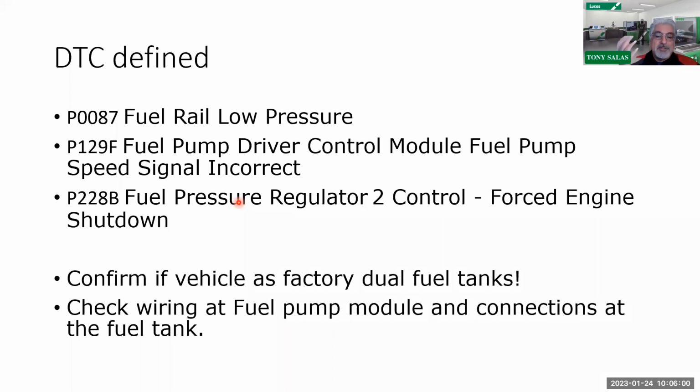But I'll be honest, I even looked on some other service information like Identifix to see what fixed a lot of these problems. Yeah, a lot of guys have replaced the connector off of the fuel rail pressure sensor, and that was the problem causing this to occur. So now this truck has only 1,400 miles, so yeah, I'd probably be going after that connector. But again, do I have contaminated fuel as well? So let's not forget those basics too as well.